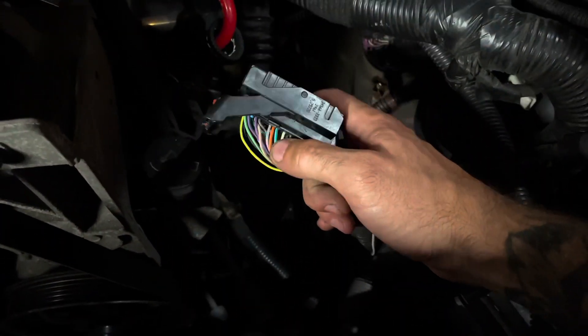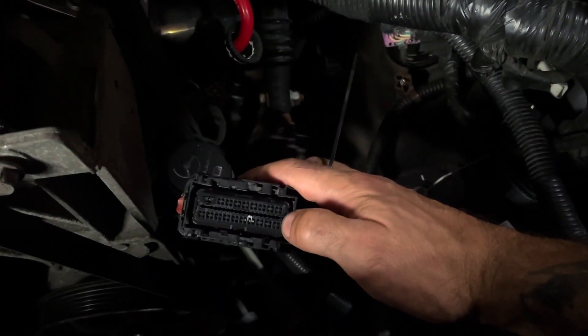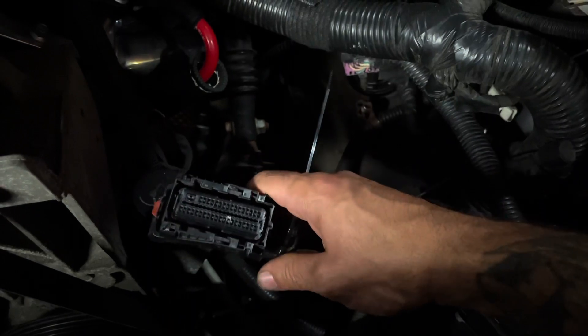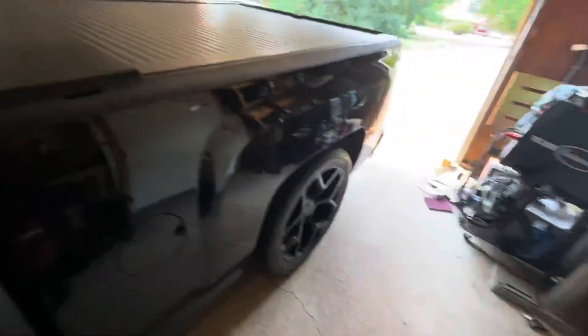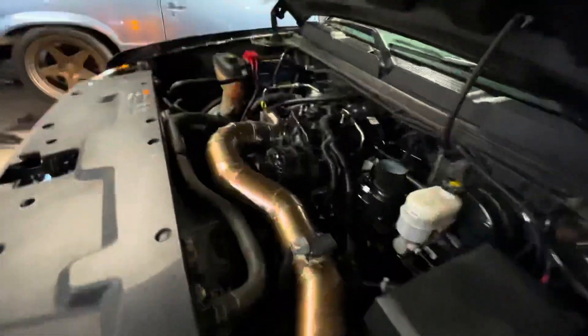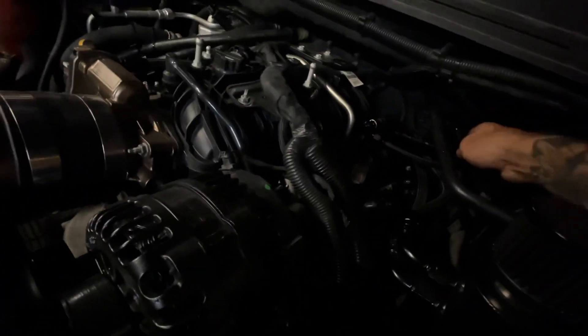Got the pin in. So it's this white wire — pin 40. I've got it highlighted there. I've got the cover back on it, but that's just easier for you to see. It starts on this side, one row up. I'm kind of upside down right now, but 33, 34, 35, 36, 37, 38, 39, 40 — that's the highlighted one. So that's the pin you need in order for the ECU to recognize the flex fuel sensor and to be able to program it in HP Tuners to say that you have a physical flex fuel sensor. Got it all buttoned up. First thing I want to do obviously is check for fuel leaks with that new system in there. I don't feel any leaks or anything, so I think we're good to go there.